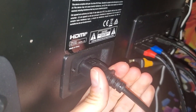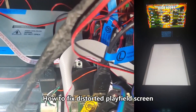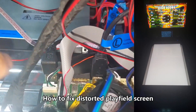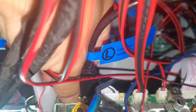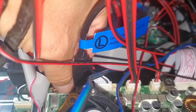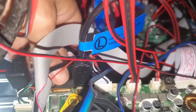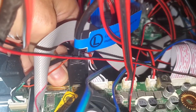If you're experiencing any kind of display issues, the first thing you want to do is unplug the power cord. If you're having playfield display issues, reseat the playfield cable on the motherboard — put your fingernail under the latch. This is a locking latch and you want to lift up on that latch, then grab the cable and the latch and remove it.